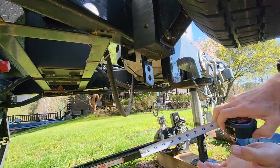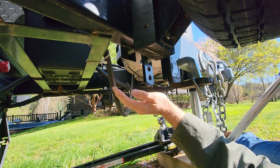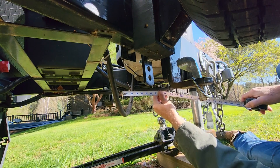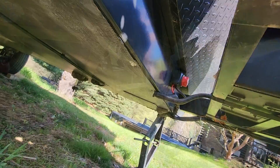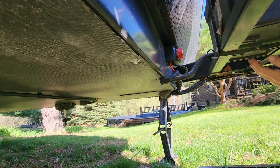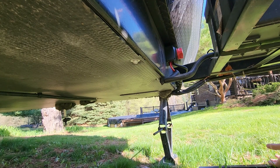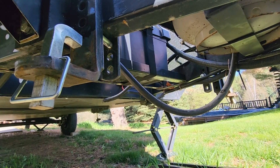We've got this obstruction here — the tire can't come forward from this point, but it can arc in between them. I measured about three to three-and-a-half inches of clearance from there, and it's a 27-inch tire. What I'm going to have to do is move this clamp from its current position out to the side or the bottom of the battery box — same on the other one, I may need to move two of those. Next I need to take the spare down and use a floor jack to temporarily hold it up in that spot to reconfirm my measurements.